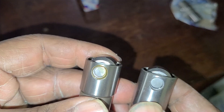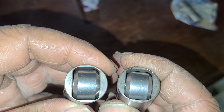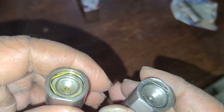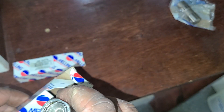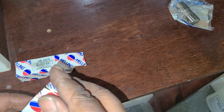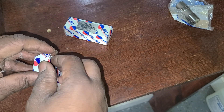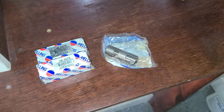Do you see that? Now the roller wheels look the same. But the really important thing is this pushrod cup. Because if you use some of these and some of these, your pushrods are going to land in at different depths. And you as the engine assembler — no matter if the parts are new, used or whatever — you are responsible for making sure everything goes together fine and everything is good. So that's why you always inspect your parts.